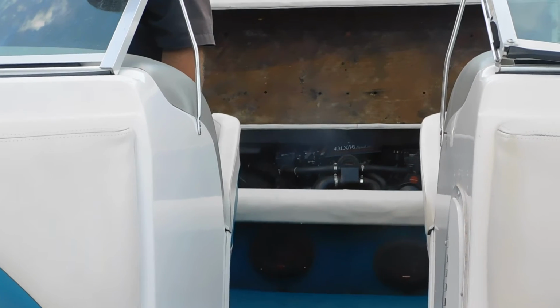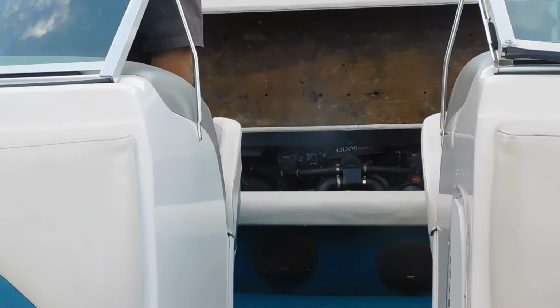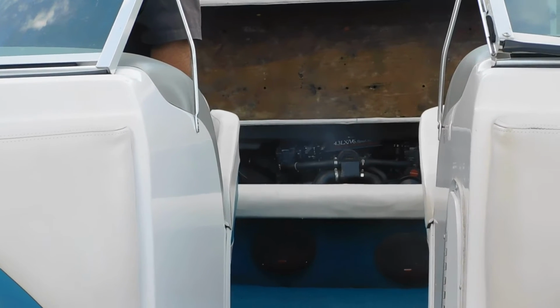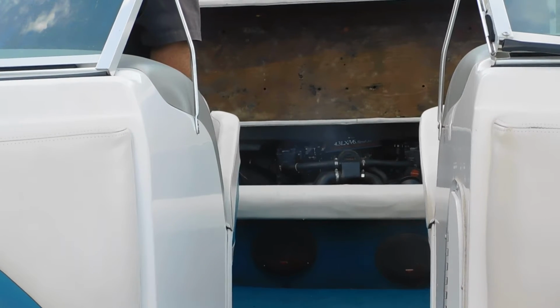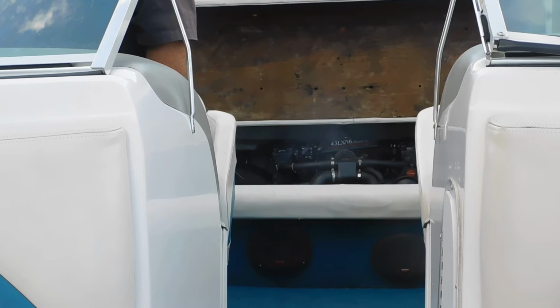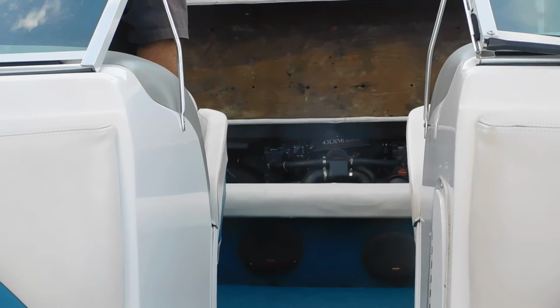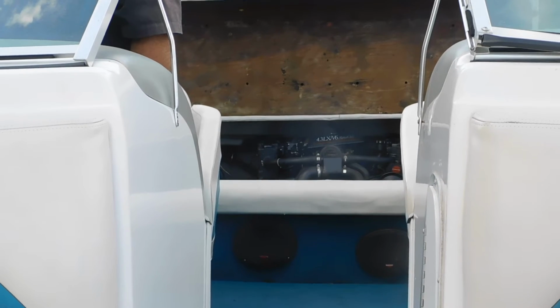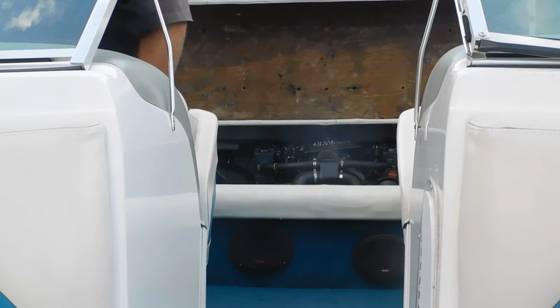This boat has an inner shift cable issue, and it got filled up with water because the boot's bad. And the inner shift cable's tight, so when you put it into gear, it tries to kick the shift interrupt and kill the motor. So it doesn't want to come out of gear either. Go ahead and try dropping it in gear, see what happens.